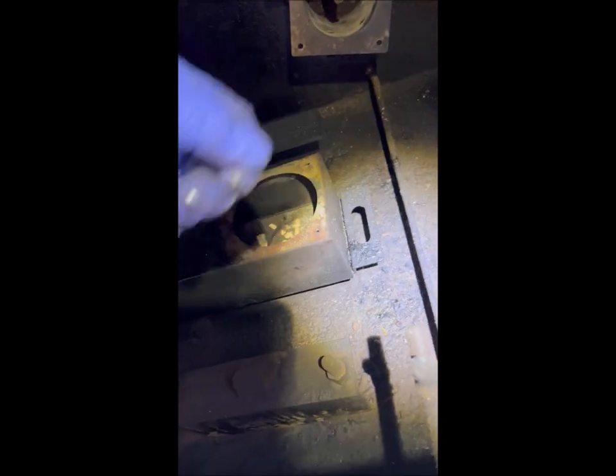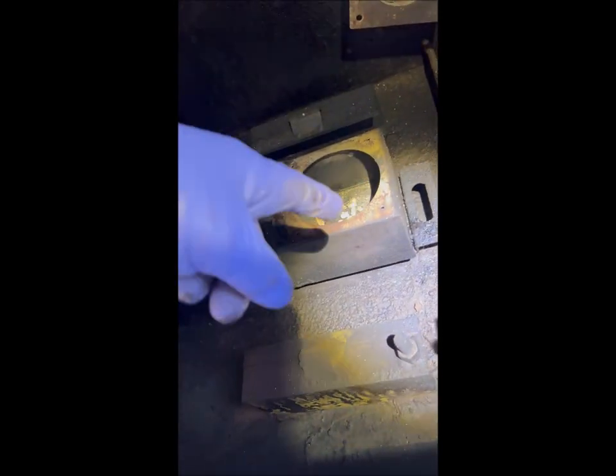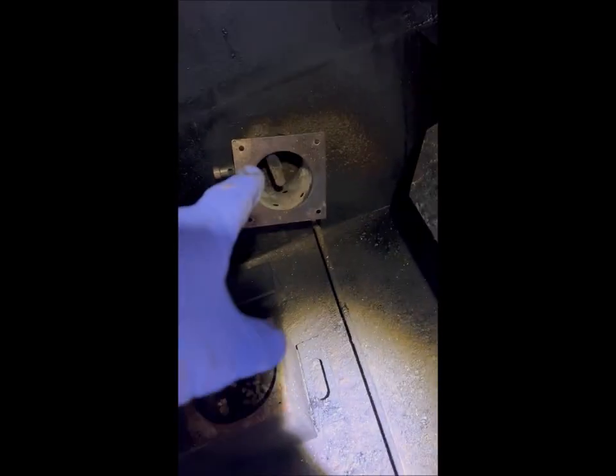I decided to shoot a video of this while it's cooling. What I'm going to do is tape this end of the new hot rod with electrical tape to the connector of the existing original hot rod that's in there. I'll tape the two together and pull the old hot rod out from the inside — and all this should pull through. Then the new rod will be attached to the end of that, already plugged in over there, and I just have to put it back in.